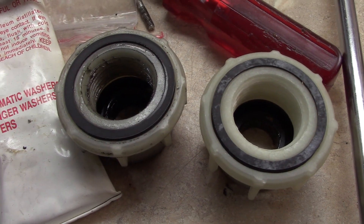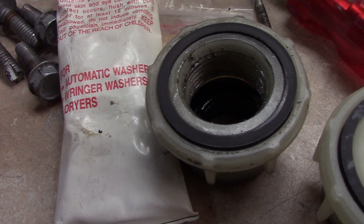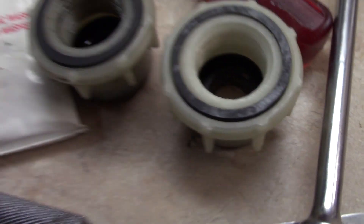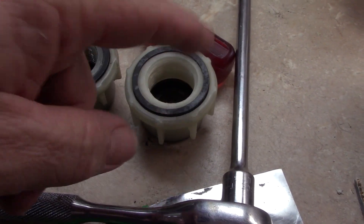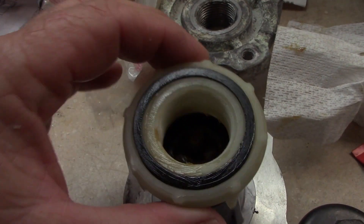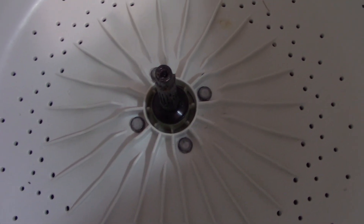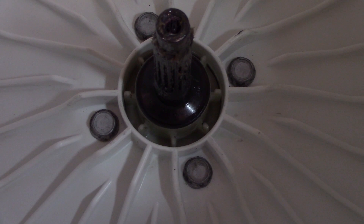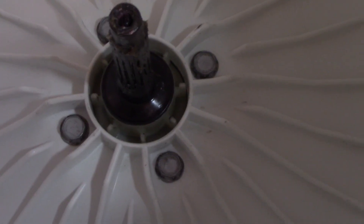Here's the old, here's the new. What I've got to do next is put the center seal grease on it — it looks like it was watertight, best I can tell. I'll put that center seal grease in there — the service manual says to put a thin layer of center seal grease on that as well. Center seal grease is applied — that should be sufficient. A few moments later that's back in. I prefer this older style seal because it's got these little splines around it that seem like they'd put more support on the inner tub.